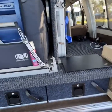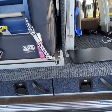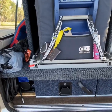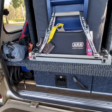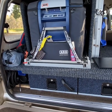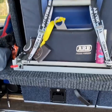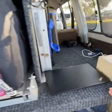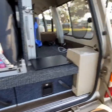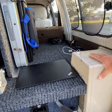Under the drawers I used 18mm ply. I wanted to lock it down without putting new holes in the truck, so I reused the bolt holes from where the rear row of seats were — they're serious bolts used to bolt down seats. I built the wings off the top of the drawer as a custom solid top. There's a wing kit you can buy for these drawers, but I highly doubt they made one for an HJ61 with the rear air conditioning compressor in the way.